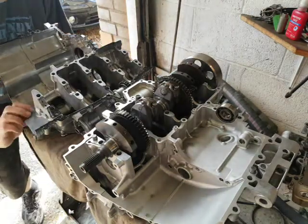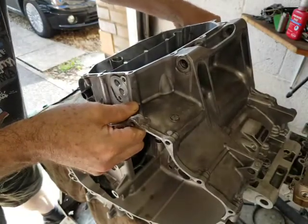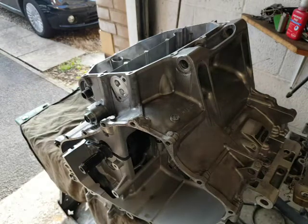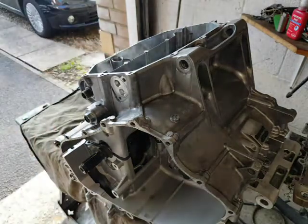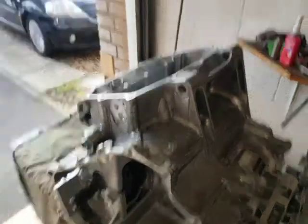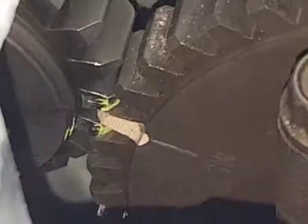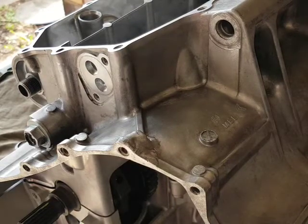Basically that is ready. I'll drop that over, carefully inch it down, and make sure the cogs are engaging visually. I'm going to check that with a torch. I can see that is engaged. Zooming in, you'll see before I drop this down the last centimetre - the one tooth is engaged between the two on the balancer wheel. That is absolutely perfect; it's not going to rattle and vibrate because it's the wrong location. I'll tap this down with a soft-face hammer and we're good to put the bolts in.